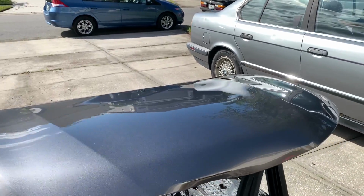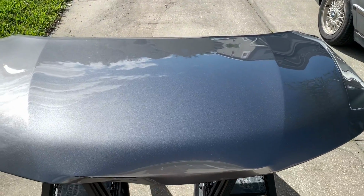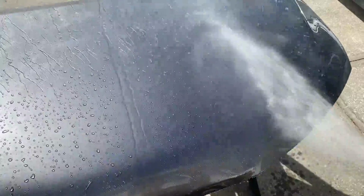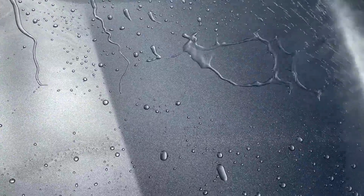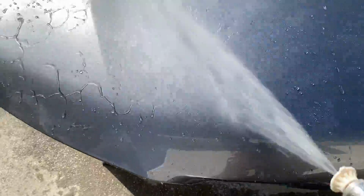And in terms of application compared to one another, I think the Best of Show spray wax is a bit more, I want to say oily, but when I talk about products having more residuals left behind on the paint after I try and wipe them and buff them off, I'm going to see those residuals more with the Best of Show spray wax side compared to the ceramic 3-in-1 wax. And some of those oils or residuals, when they're on the surface, can actually increase the depth of the paint when the sun hits it. But on this type of lighter panel, that's not usually something that I can really notice on this type of color here. This is like in between a gray and a darker silver color.